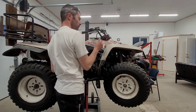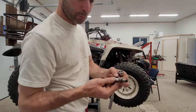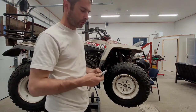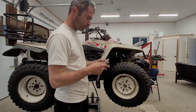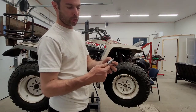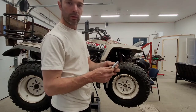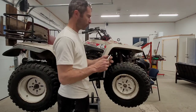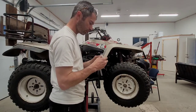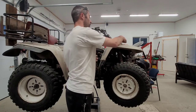The threads are super hot on this thing. It actually looks pretty decent — probably one of the reasons why it fires up so easily. It's still in good shape, but I'll put a new one on anyway and keep the old one for the trail. Something to note: this plug has a crush washer, so unlike certain other motors that have a tapered end to the spark plug, these ones here you have to go a little more than just snug. It's about half a turn once it's tight — sometimes it's actually written on the box.